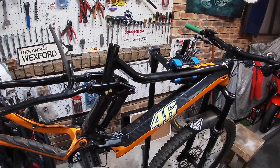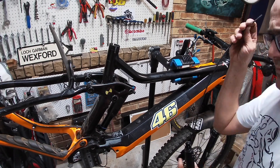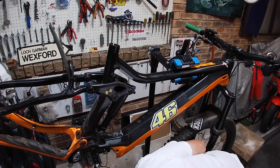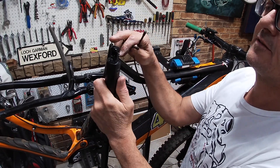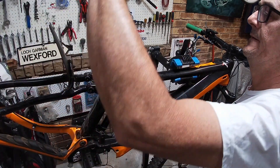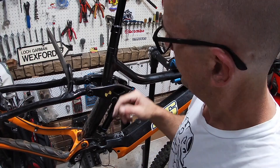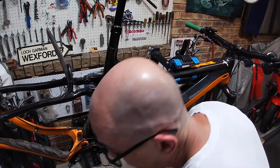I'll snip this. Okay, I've taken about 50mm or so off this old cable and put the old ferrules back on. Because now it's a case of — you go there, through the seat tube — let me just get our eyes on that — so I can house that little ferrule in the recessed part. In it goes. I'm using this to check the length — can't go anymore because there's a bend. Because like I said, it's a slightly longer post, but what I've lost in that I've gained going deeper into the seat tube.